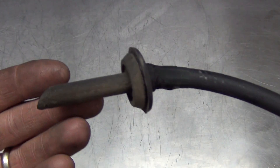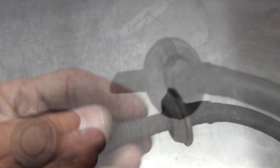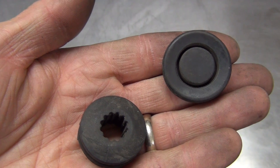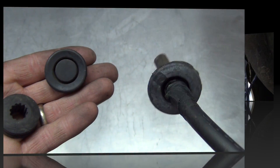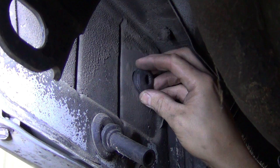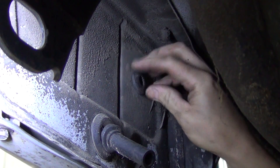With the wiring done, it was time to run the boost and alcohol lines. I chose the spot in the trunk because there's an access hole close by that is well away from any heat sources. Since you can't leave the lines hanging out like this, I took a look at the rubber plug that was previously in the hole and found a close match in size. This is an old DSM rubber shift bushing — I never throw stuff like this away as they can come in handy later on. I popped my new rubber plug in and ran my alcohol and boost lines through it and up into the trunk area.